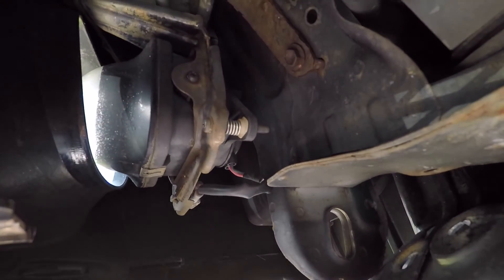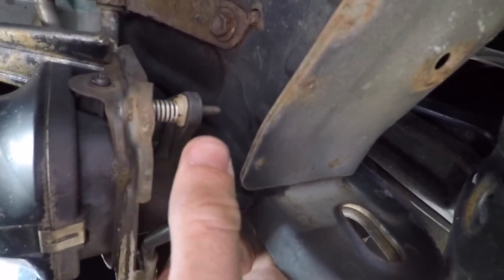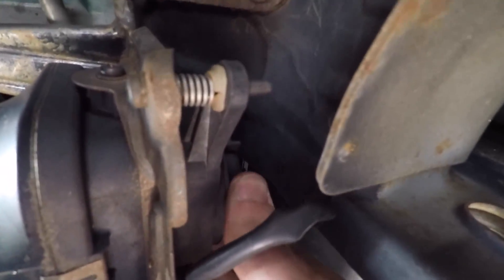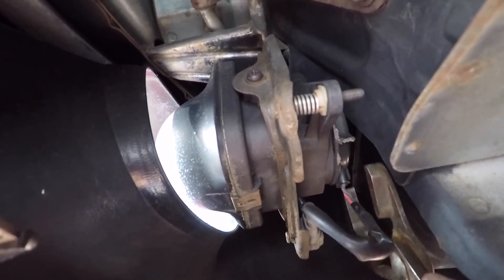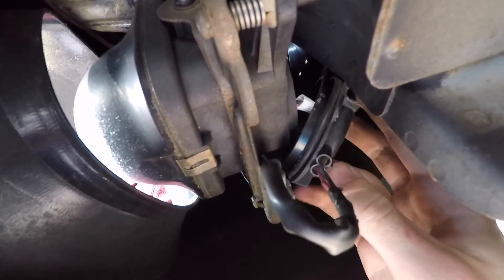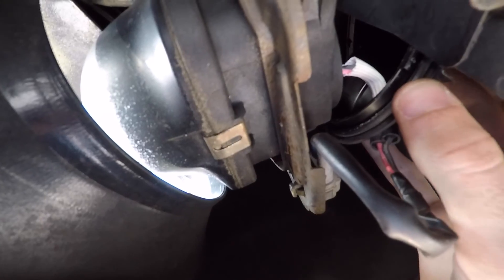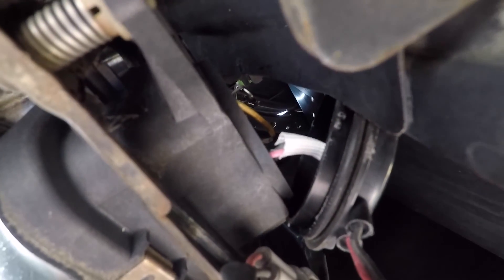This is the fog light mechanism. What we end up having to do is take the back cap off right up here. It's just righty-tighty lefty-loosey and it does pop out — you can feel it going, it's kind of stiff. There it goes. The cap is off, and you can see inside there's the yellowish wire — that's the old cable. There's also the new white cable and another pin you have to unplug. One is the ground, one is power.